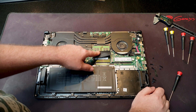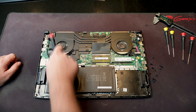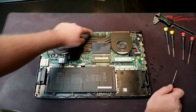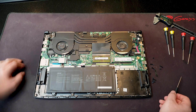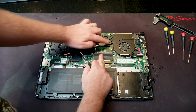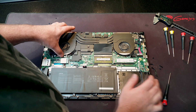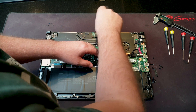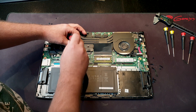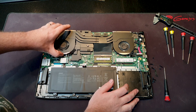Next, remove the heat sink. We've got a lot of screws — the little ones up here are to clean out the fans, but that's not what we're doing now. We're just going to remove the heat sink itself with all these screws. These three don't come out, just unscrew them. These two don't come out either. Now we can just lift it up — there's one I forgot. And there's one hidden over here, very important that you don't yank on it, otherwise it will end in tears.